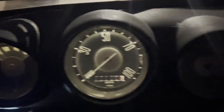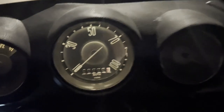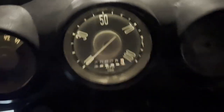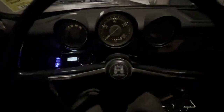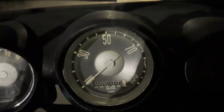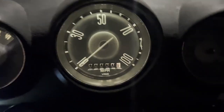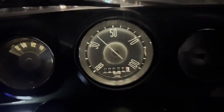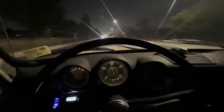I'm going to go for a test drive and we're going to see if my gauge works. It was running really weird at first — I totally forgot to put the linkage for the carburetors on cylinders one and two, so I was only running on two cylinders. But I have that back on now and the engine is running fine. Looks like my speedometer is working, and the odometer is working too. I'm just going to go for a joyride, I think I might go get gas, but so far the engine's running really strong.